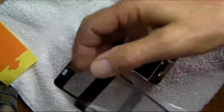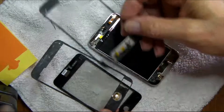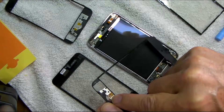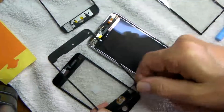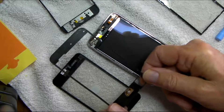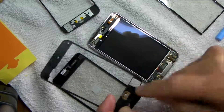So you have to be careful of that — be sure to dry-check all these parts before you start. Also, on the snap-in bezel for the Generation 3 at least, there is a mini-switch here that is a wraparound small flexible circuit board card. I had to remove it from the old bezel and put it on the new one. It has some stickum on the back that holds it together — I believe it's a conductive stickum, so you can't put glue down on it because it'll break the ground connection.